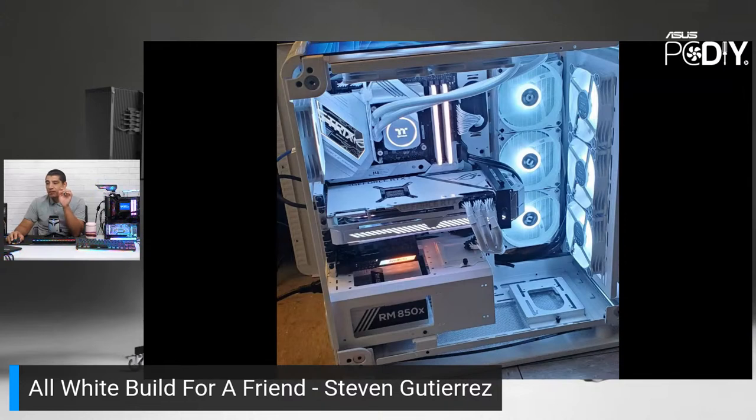What they're most proud of in the build is just being able to get it all put together and up and running. I guess all of us agree, right? When we put it together, we just want to hit that button and have our system work. Is there anything they would change about the build? Maybe upgrade to a 1000-watt power supply. I could see that having a benefit, especially with the 3090 GPU. It's an OC-based model too, plus you might be running overclocked. The transient response on a 3090, you can actually peak over 750 watts, 850 watts. So having a 1000-watt power supply is nice to give you that extra comfort, right?